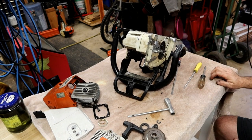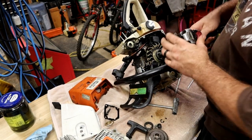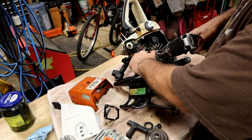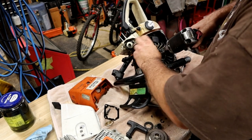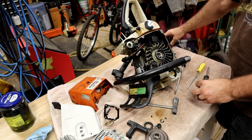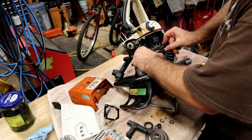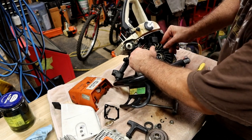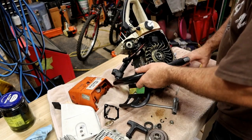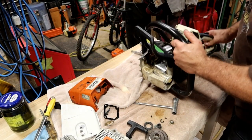Let that finish draining out. Okay. For the flywheel side, the nut comes off regular, counterclockwise. 9/16, 14 millimeter. It was a little on the easy side, but they're not always hard to come off of there. So right now I'm just trying to retrace steps to see what all was touched to verify it was installed correctly.